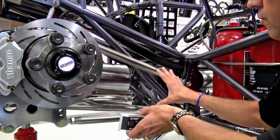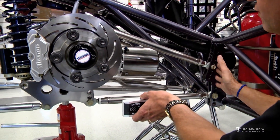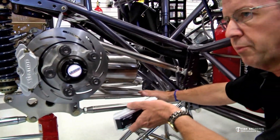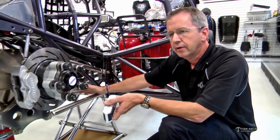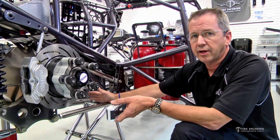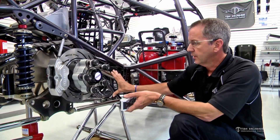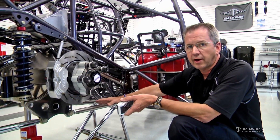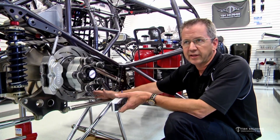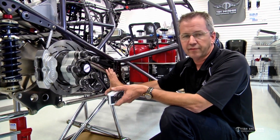That's a very simple explanation of the four-link. There's a lot more technical stuff as far as the spread on the rear and how long the intersect point is based on the front and rear percentage of weight in the car. We get calls all the time where someone says they need to know where to set the four-link — but there isn't a general setting for every car. We need to know the total weight, how much is on the front, how much is on the rear, what power it has. It's also important to know where you're going to run the car — a lot of difference between a marginally prepped track every weekend versus a very well-prepped, sticky racetrack.